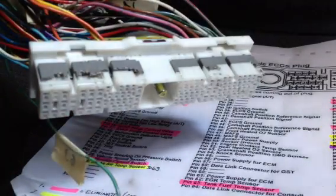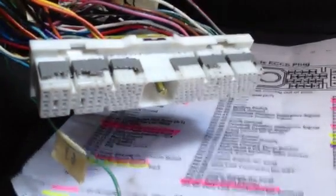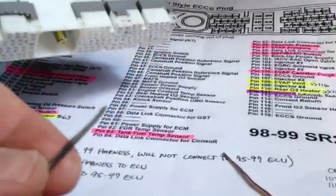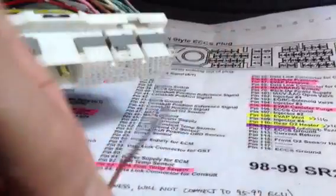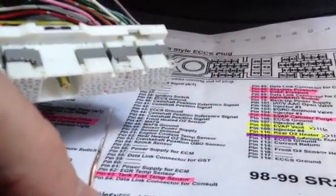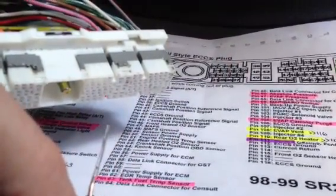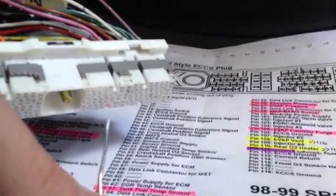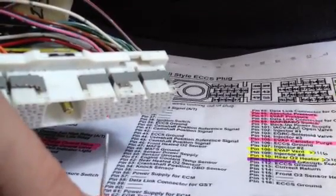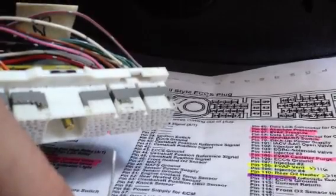I have two tools that I use for this that I kind of made on my own. A filed-down nail right here. I also have another smaller one that you can use to push through the top of the pin where the actual ECU pin slides through. What it will do is actually push the pin out of the hole.